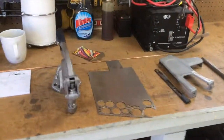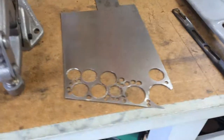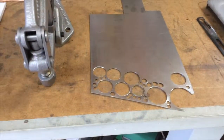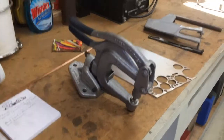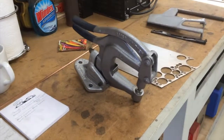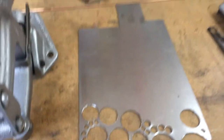Anyway, we got our oversized Whitney punch that showed up and used. As you can see, we've been making plenty of use out of that. It didn't do those big holes. The big holes were done with a hole saw. This punch goes up to 7/16, I believe. It's pretty aggressive. So far, you can see the bigger of the small holes there, roughly 3/8 of an inch.